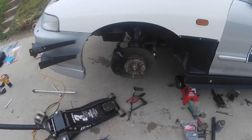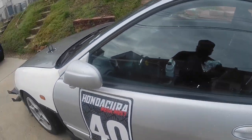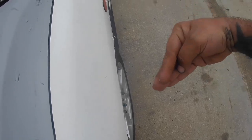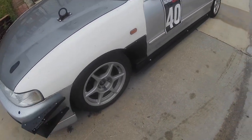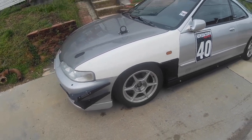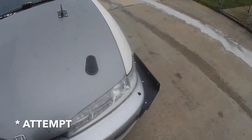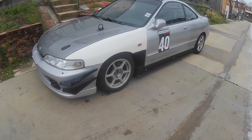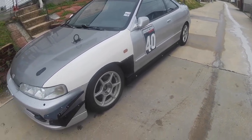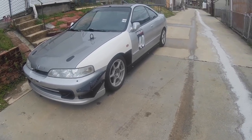It's the next day. We got this side done — I still have to tighten the axle bolt, but the steering wheel is straight. However, looking straight down at the wheel, it's coming in towards this way. I tried to adjust the tie rod how the stock one was, but being an aftermarket outer it's a different length. Since this one's still straight, I'm going to try to do a string alignment to get it close, then I have an alignment appointment in the next couple days. I'm going to push the car back, get it straightened up, and set up the string alignment.